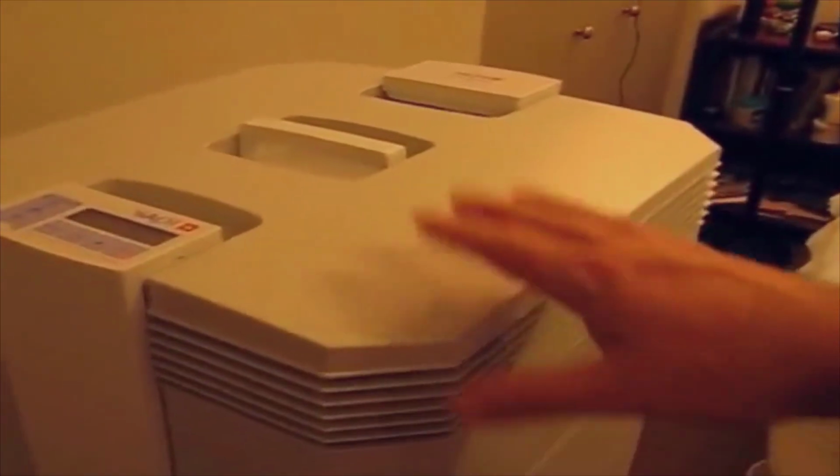So definitely a strong positive there with that activated carbon and activated alumina filter in the middle here. Finally, the HyperHEPA filter that is up top here. Again, it is a true HEPA filter, just like every other true HEPA filter on the market. However, there is a lot of filter media there, and that filter is going to take a lot longer to saturate than most other true HEPA filters on the market. So a strong positive there all around with all 3 filters here. In terms of quality, in terms of quantity of filter media, you're doing very well here with the IQAir HealthPro Plus.